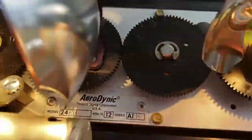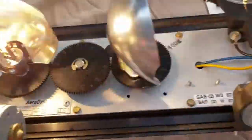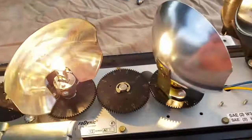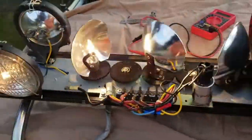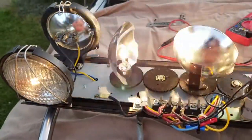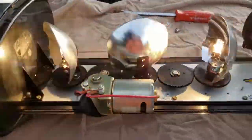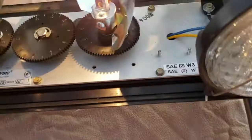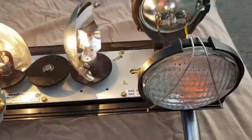Just a quick video tour. This is a 24EH A1A — so basically end lamps, which are halogen bulbs. She works. This is my burn-in test at this point, just making sure the flasher and motor are going to work. I do need to add some grease — you can hear it's a little noisy. The build date on this bar: we've got '87 on the bar and '87 on the motor, so this bar was probably made in 1987.